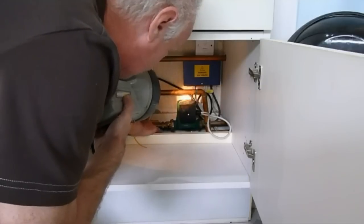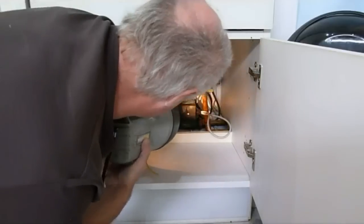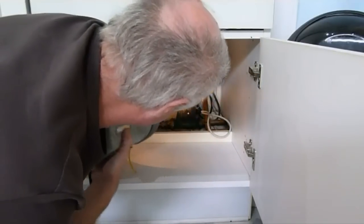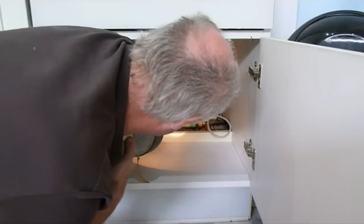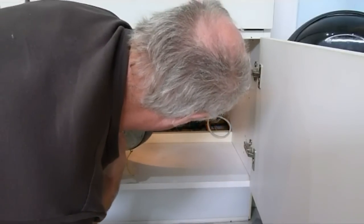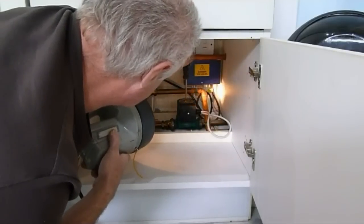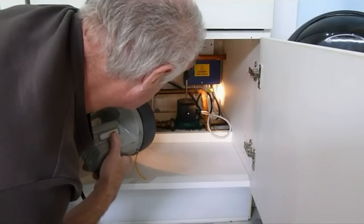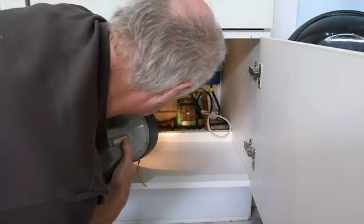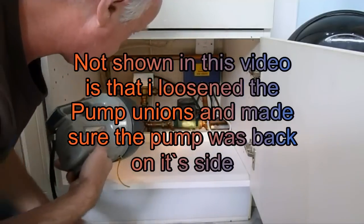Now the pump is connected. One of the last things to do is to vent the top of the pump. Because you've put the new pump in, there's a little screw on the top which allows you to get the air out - just unscrew that and bleed it, let the air out. A lot of people do it with the pump on as well, just to let that air out, then screw it back down. And basically, that's your job finished.